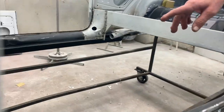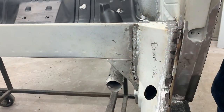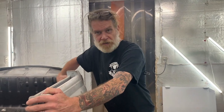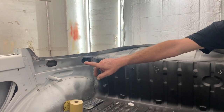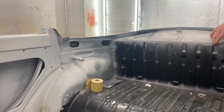Also inside here, it's got a second inner firewall or wheel well. And then back here, to add extra support, it's got another brace here, which has actually conveniently attached the seatbelt mounts. And that's pretty much it. There's a little bit of extra strengthening back in here. All this structure is not part of a normal beetle. And typically we don't have that much welding and that much panel in that back section either. So that's also one of the reasons that convertibles weigh more.